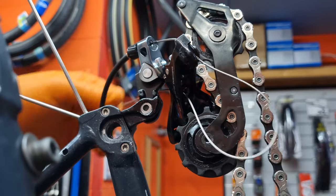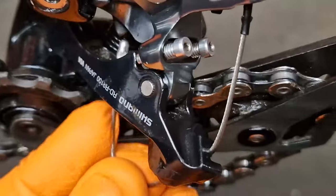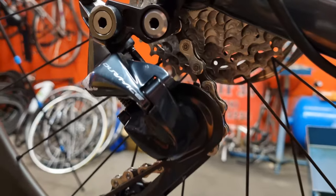That's all set up and ready to give back to the customer. Some of you might be wondering when I'm going to put some lube on it - I'm not going to, because I just cleaned it with lube. You'll have seen earlier that I tucked the rear gear cable up through the parallelogram of the rear derailleur. The reason I've done that is because you can leave the cable longer - Shimano say to cut it off at 3 centimeters so it doesn't go into the wheel or chain. But by tucking it up through one of the holes in the parallelogram you can leave 6 centimeters, or 5.5 centimeters as I've left on this one. That means you can cut the cable off more times, saving you time and money in the future. It's also a really neat way to tuck the cable away so you can't see it.